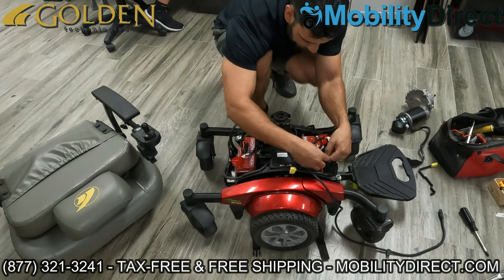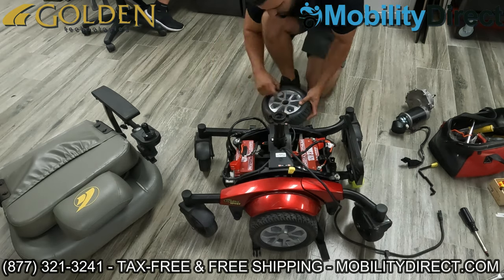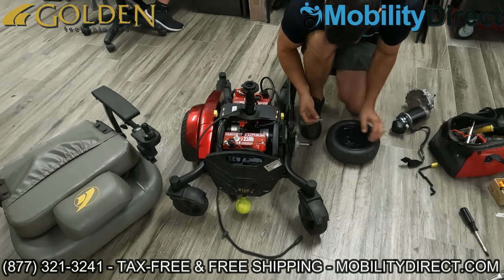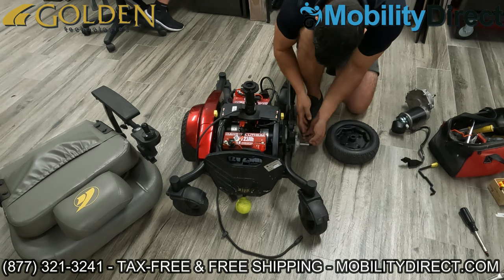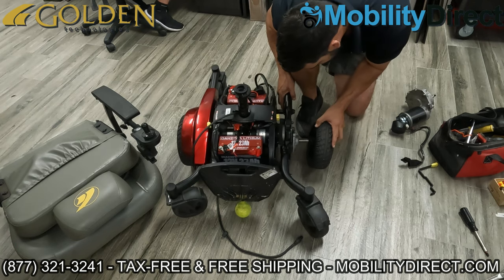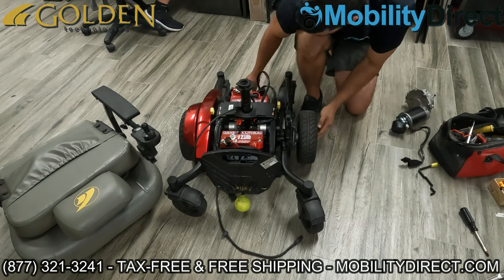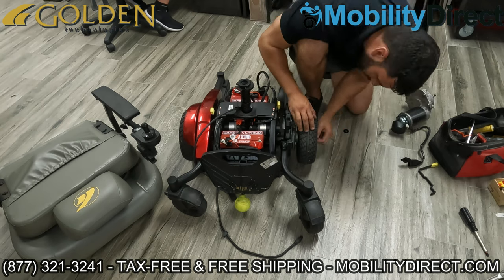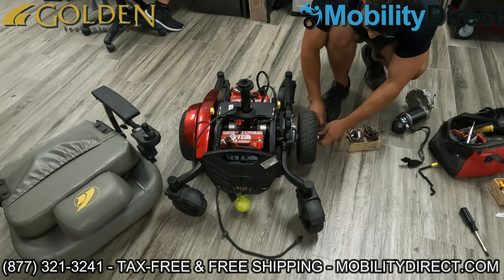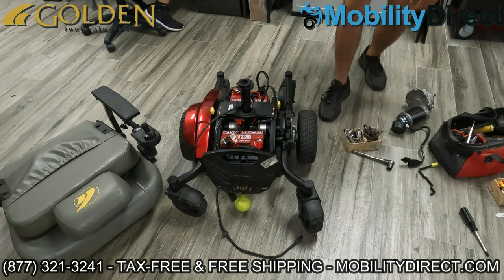Once you have the batteries installed, install the tire that was removed. In order to remove the brake and motor assembly, you would need to remove the tire, so we're installing the tire now. As you can see, I'm installing that key which locks into the axle — it's a magnetic key, and there's a little slot on the inside of the rim where that key slides right into. That's how the wheel is allowed to lock onto the axle so that when the axle's spinning, it rotates the tire. Make sure you don't lose that magnetic little key. Just reinstall the washer and the bolt and get everything nice and snug.